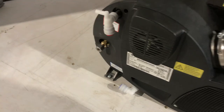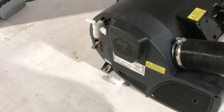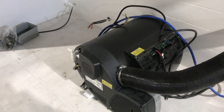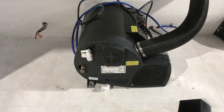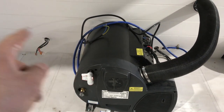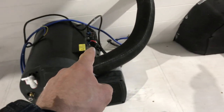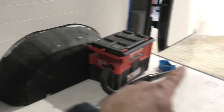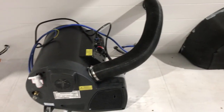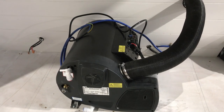What I'll do now is start to make the connections with the hot water and cold water, and then I'll leave the gas but I might cut the drop vent for the LPG part to run to the manifold. I've put this in just before the unit goes in so that I've got good access to all of the screws. It's going to have four heat ducts coming out the back — one going to the shower, one out the skirting board here, one at the other end of the skirting board in the living space, and one through the wheel arch box to warm up the garage space. It'll be quite nice under-bed heating as well. All four ducts are recommended to be used, spread evenly from the front to the back of the van.